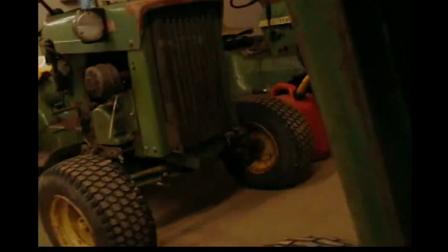But what I think the problem is, is the governor arm. I think I might need to adjust it. If you guys remember on the round fender, we had to adjust the governor on it, and I think we may have to adjust this one. This is how far back it goes. So I might have to take this off of here. I'll do it later, but I think the governor might need to be adjusted back some. I've done it before. Well, it does fight you when the engine's running, so it's a good thing.